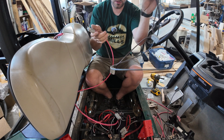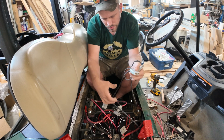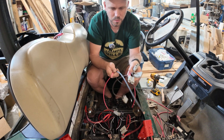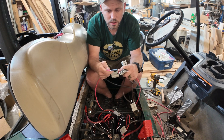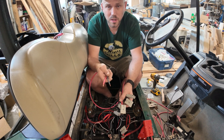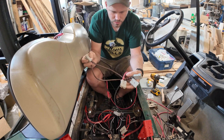To hook this up to the charge controller I made this wiring harness. It's just a negative wire that goes in here, comes out, goes into the next one, goes in and out, and so on. This gives us a positive wire at the very end, so you end up with a negative and a positive wire — this puts the four batteries in series which gives you 48 volts at these points here. You can then put a connector on the end and charge all your batteries at the same time if you have a 48 volt charger.